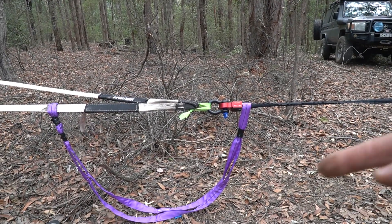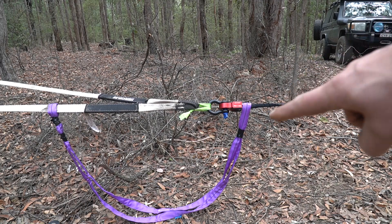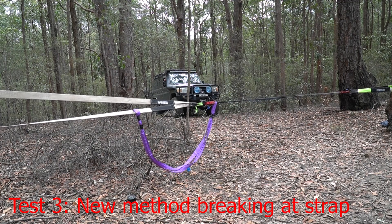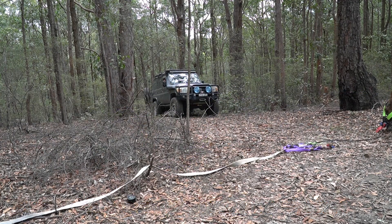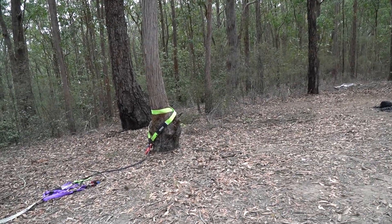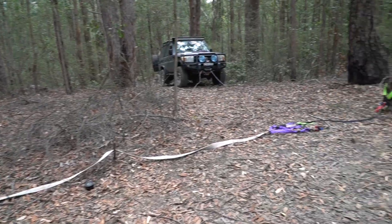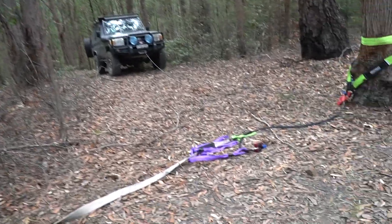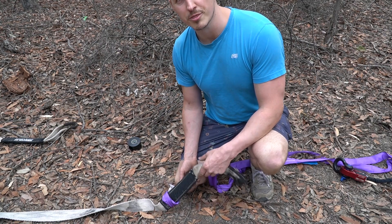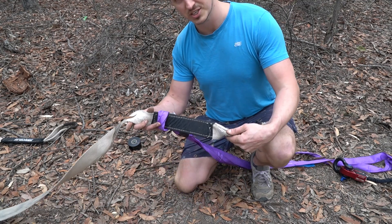So this is what I'm going to be testing now. I've put a strap at either end of the brake point. When I bought these straps I thought they were loop ends rather than a whole loop, so I've put some tape here to make it act like the intended product. Let's see if there's a difference in this setup. What have we learned from this one? Well, the rope is here instead of all the way over there, which means that everything would have been contained in this little area, which should be nowhere near anybody anyway. One thing to notice is that it only flew so far because the strap became unwound from the tree, but that stole a lot of the energy out of the braking rope. The ropes never came detached.